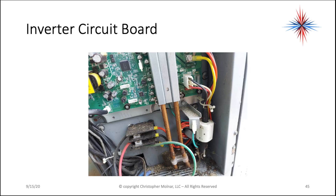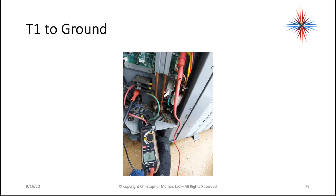A little bit of a closer look here — this is my line coming in, everything else happens on the circuit board. Slightly off the picture, you have three terminals. You can almost see there's a black wire, a red wire, and a yellow wire — those are my three terminals going to the compressor. Sometimes those are difficult to find, so you just have to look hard for them. We don't have start, run, or common with these compressors, so we have to call the terminals something else.